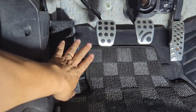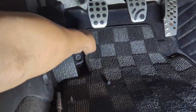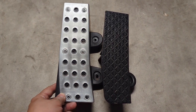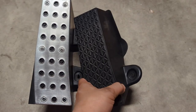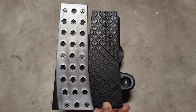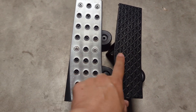We are in the home stretch. The last thing we need to do is install the pedal cover on the footrest. We can just remove this screw and it should just pop right out. The RX-8 footrest is a little bit taller and has two bolt holes, while the Miata only has one. So when we install it, it's going to sit a little bit taller at the top than what we have on the Miata, but that should be fine. To remove the old cover, these are rivets, so we'll have to drill these out, drill our holes here, and then install new rivets.